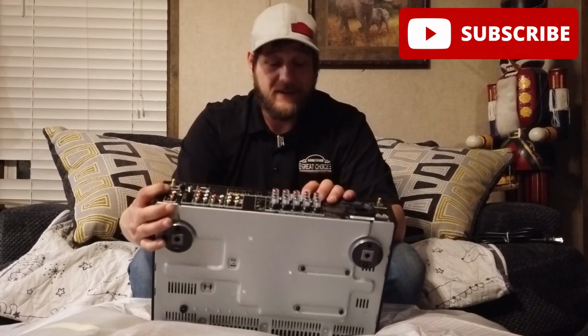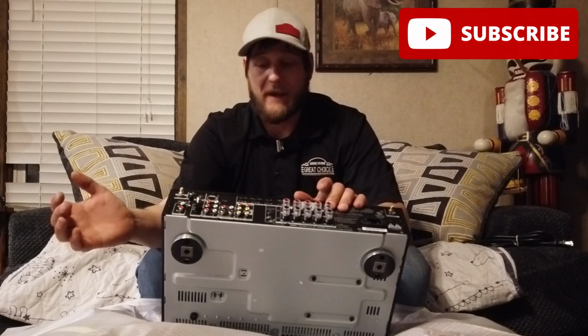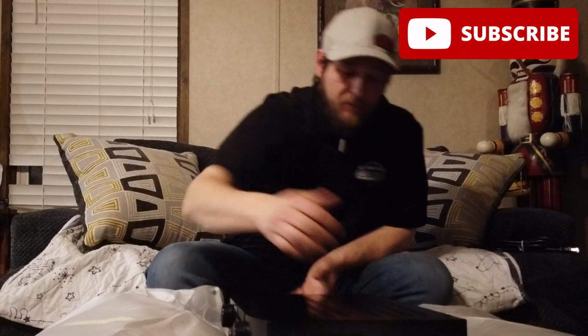If anybody these days is doing it, you're going to use this ARC port through your HDMI. If your TV doesn't support it, run that optical though. Just for a backup purpose, you can run the optical as well, but you're not going to use it. If you want the full features, you're going to use your ARC port. So let's spin this puppy around.